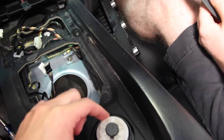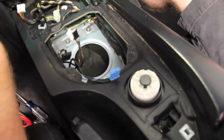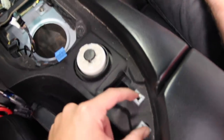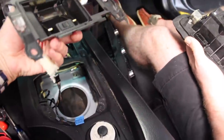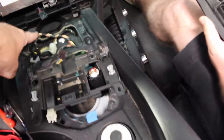The iDrive knob simply lifts off — just grab both sides and pull straight up. It clips on. This is CCC navigation; CIC would be similar, only on 09 and 10 models. Then there are two silver T20 Torx screws down here that hold the center console in. There are also two pins at the back that sink into acceptors, plus two more T20s up top holding the ashtray and lighter element. With all of that off, two more T20s are revealed — tricky to reach but a normal T20 screwdriver works fine. That whole assembly comes out.